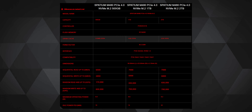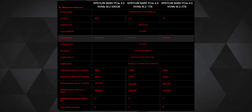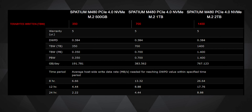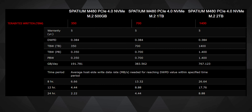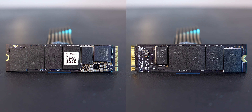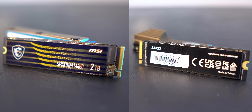The paper spec performance of the 1TB storage drive is quite close to the 2TB variant I have here, but the 500GB variant — which isn't available in many countries — has drastically lower performance, so don't let the performance charts give you the impression that the lower-tier storage variants perform the same as this 2TB variant. The endurance of the 1TB drive is 700TBW and the 2TB drive is a crazy 1400TBW, so if you're a data cruncher of any sort, don't hesitate to go with the 2TB variant.